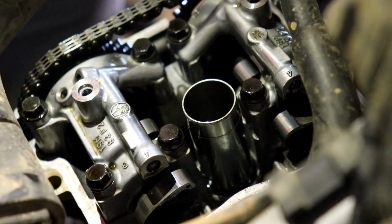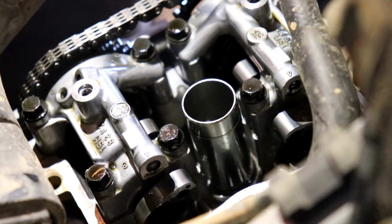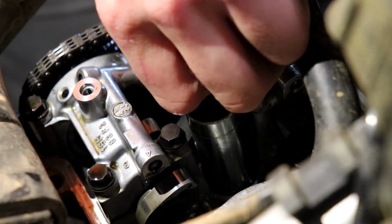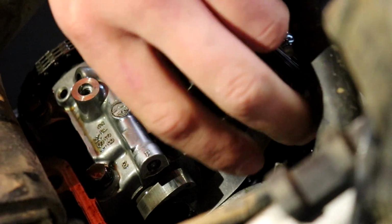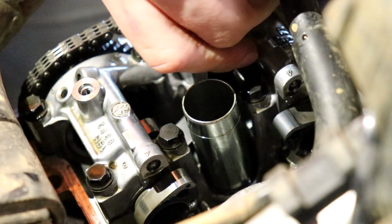Exhaust is supposed to be 0.17 to 0.24. So find the closest thing to 0.17. Yep, look at that. Fits. Crazy. That one fits too. Awesome. 0.23 apparently. All right, well those don't fit, but either way it's still in spec. 0.16, 0.13 in spec. Although technically that is also in spec, the 0.13 is borderline, so that's definitely going to get changed eventually anyway.